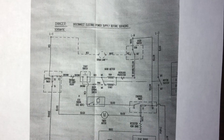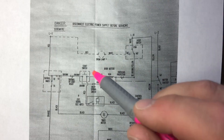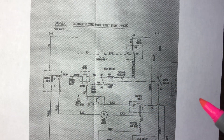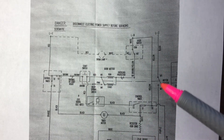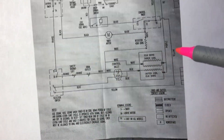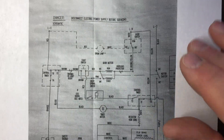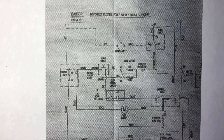We have a GE dryer motor. When you press the push-to-start switch, the motor will run, but as soon as you release it, the motor turns off. It will also heat when you're holding the push-to-start switch, but that's kind of a red herring, so let's ignore that one.